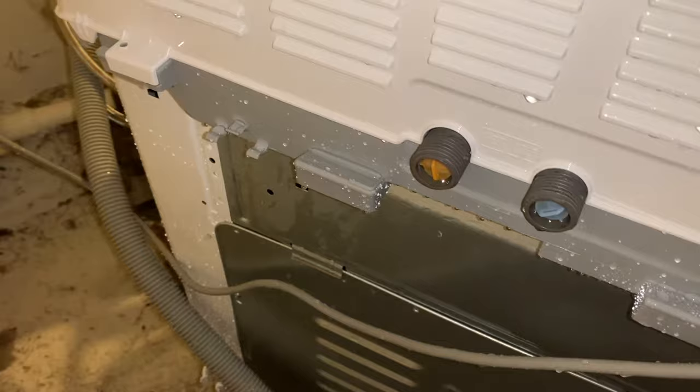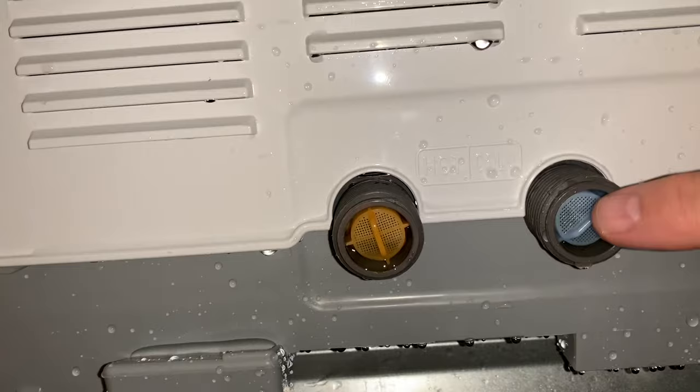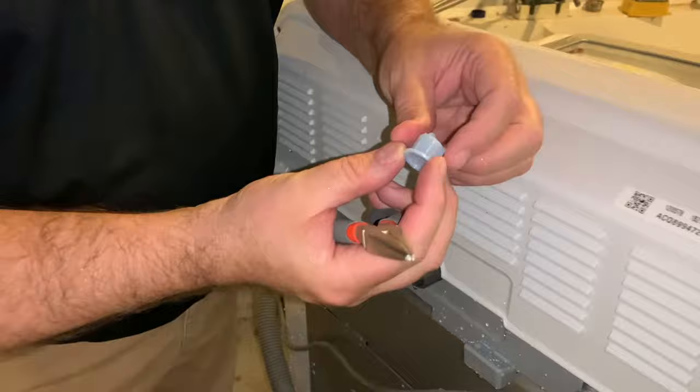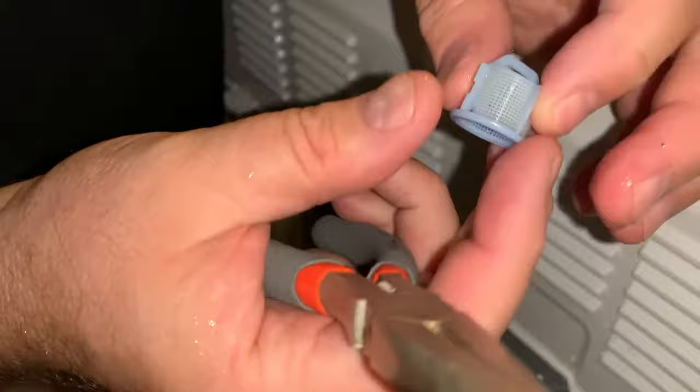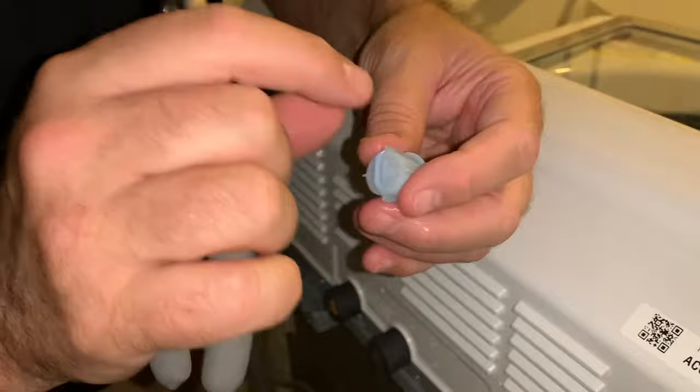Now that it's drained, you can take a look inside the inlet valves. These two ports here — there's a cold filter in here and a hot water filter in here. You can tell which one's which because this one's blue and this one's like a red-orange for hot. All we're going to do is pull those out and see what's going on. Pull out the filter using needle nose pliers — really easy to do. I'm just going to check it to make sure there isn't any debris. You can see a little there, but this is a new machine so there really shouldn't be anything going on here, and there isn't. But if there was debris or it was clogged up, that would have been the cause of your slow-filling tub.